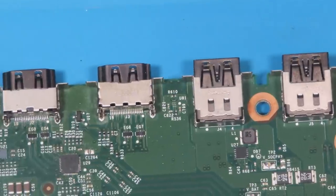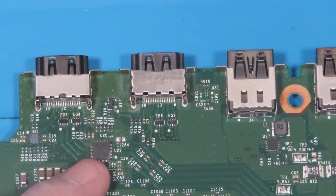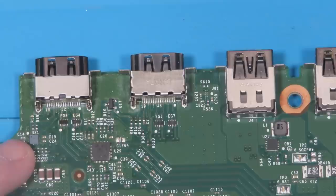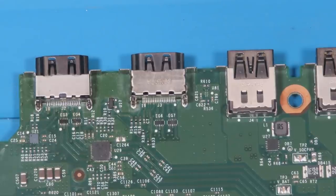There's really not a lot that can fail on these particular circuits. The main thing that fails is the HDMI encoder, but it could also be this chip here - U21, which is the ESD IC, the electrostatic discharge IC. This basically protects against lightning strikes, power surges, and protects the APU from becoming damaged. Unfortunately those chips can't really be purchased for the One X because there are no actual markings on the chip, unlike the Xbox One S which uses the HDMI C24.